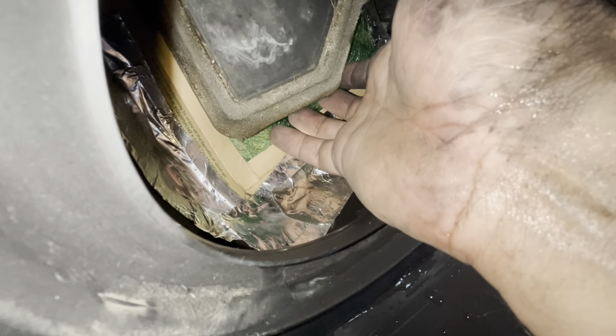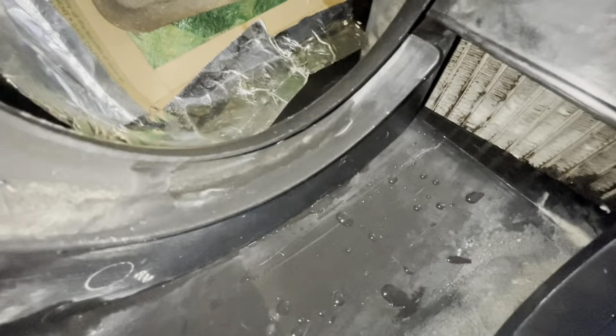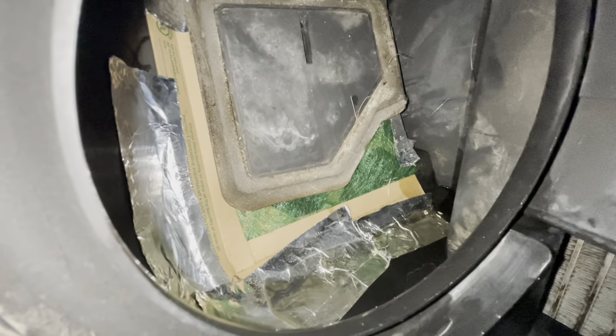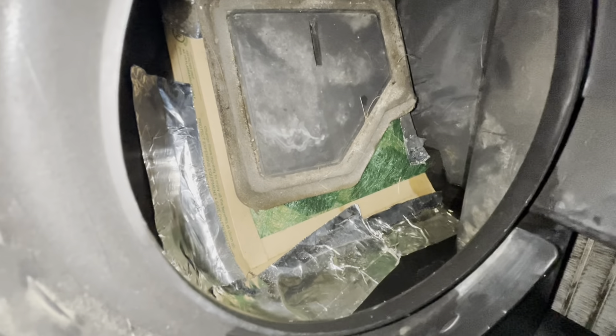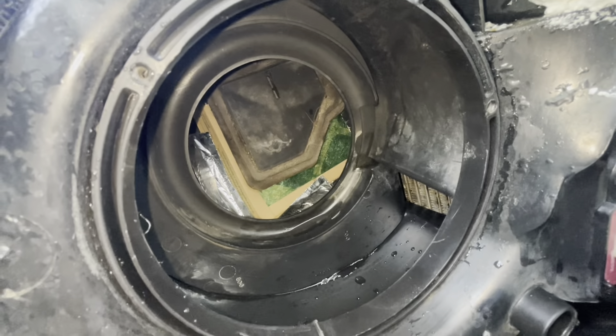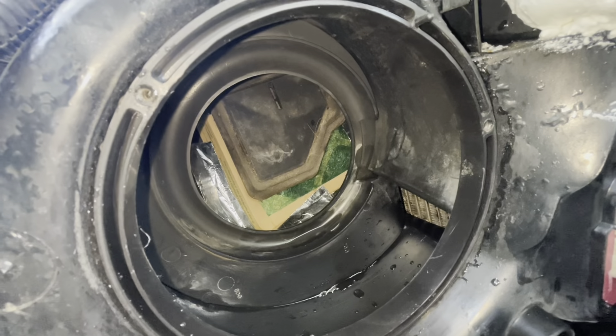I made a homemade air filter here. The flap, when you're on AC, is actually up with vacuum. I just kind of taped in a piece I cut up from a cheap high-flow filter, because these trucks don't surprisingly have a cabin air filter. So I'm using that as my cabin air filter because I think that's the source of a lot of the trouble - at full blast it's sucking everything up: dog hair, dust, blowing it right into that coil.